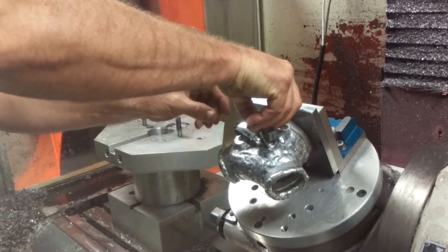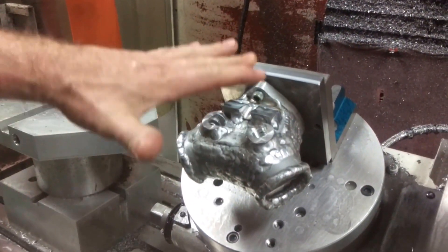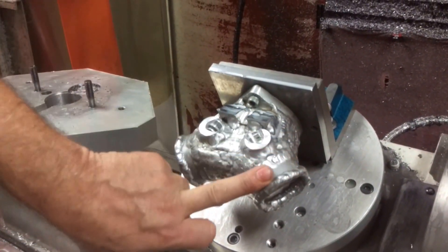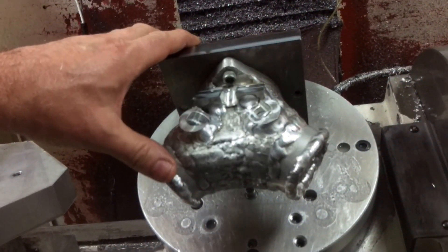I'm going to take it apart here for a minute. As you can see, we've welded that up, and then we've put all these aluminum pieces on, which raises all the fuel rails so that it makes for a nice, consistent flow. We also had to extend the manifolds because they're extremely too short because of the raised ports on the head.